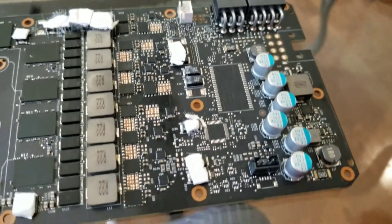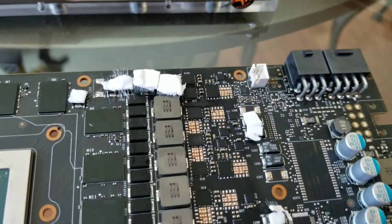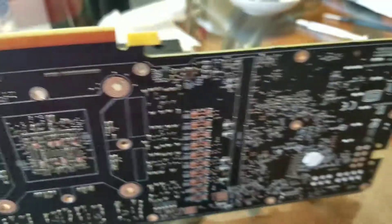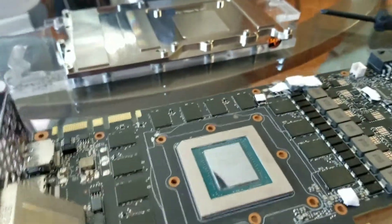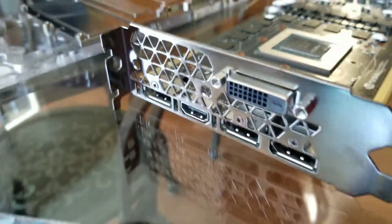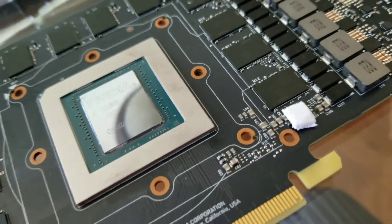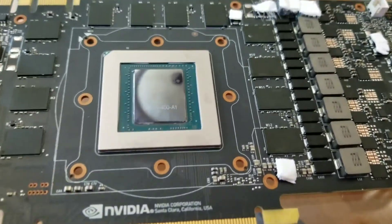You've got to make sure you unplug the fans and the lighting before you actually remove the heat sink. Off the back of this thing, all these bolts have to come out — all of them. Make sure you leave the backplate on so the backplate gets the correct contact. The IO cover and shield stay on, but you need to take out a screw here and a screw there, otherwise the cooler won't come off. If you have to force it a lot, don't — it should rotate or peel off very carefully, bit by bit. You don't want to bend or force anything too hard.